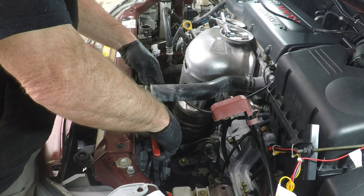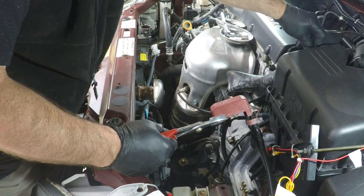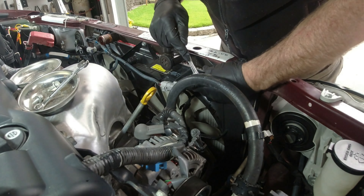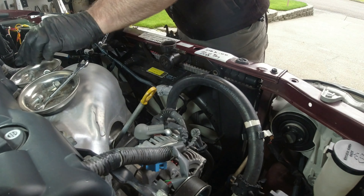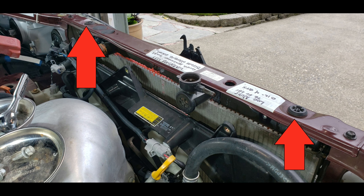Now is a good time to unbolt the fans. First, disconnect the top hose from the radiator and fold it back out of the way. The fan is held in by three bolts — remove those. This loosens the top of the fan, but you can't remove it yet until you get the electrical out of the way. Next, we're going to unbolt the top radiator support. This piece of steel is what actually holds the radiator in place via rubber grommets that hold pins on the radiator — top and bottom. In reality the radiator is just floating, which increases flexibility and prevents leaks.